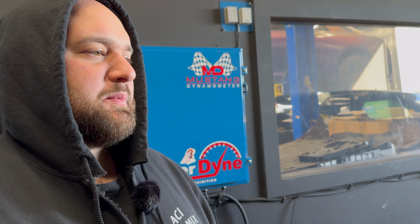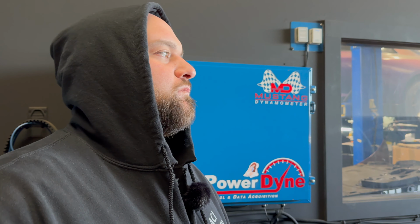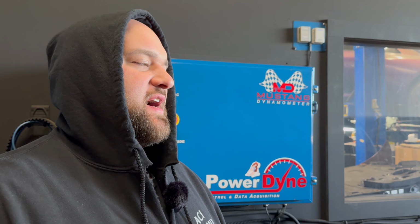Fully built engine like you saw in that video. So now the dyno runs. That 530 wheel on pump gas is probably a mid 10 second car for this car and driver. Now we're going to be putting E85 in it, seeing what we can make on E85. I would like to see like 650 wheel. I would love to see 700, but of course, without doing crazy porting to the head, 700 is sometimes a little bit impossible. So we're going to see what we could do on E85.